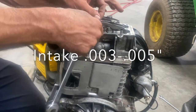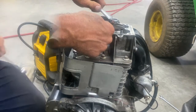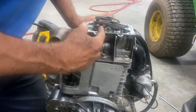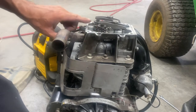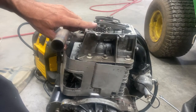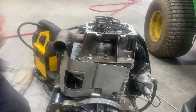I'm going to set the intake so there's a nice drag on it. Now we can see the compression bump here — watch this bump go up, all the way, and it goes back down right there. See it. Exhaust — going to go all the way up and back down right there. See it. Now that's the decompression bump that we need — that's working.